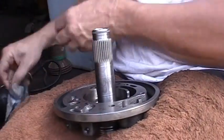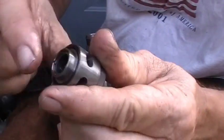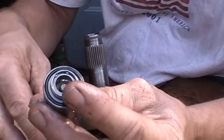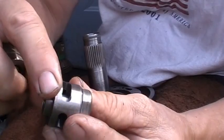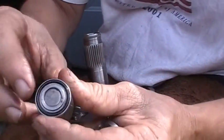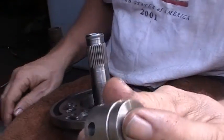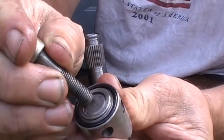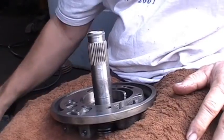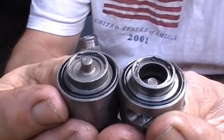Let me show you — here is an old one. See how that is down in there? It's jammed, it won't come out of there. What happens is your transmission starts getting bad and you get metal in the line, metal in the oil, and it circulates through the transmission. If the filter doesn't catch it, fine particles get down in there and jam this up, and that valve is stuck open — this is why your transmission won't move. Here's a different type of valve — there's a spring in there, and on the back side the pressure gets built up and pushes up on it. That's how this particular one works. This is a good valve. There's a good one and there's a bad one — see the difference? Valve is stuck in this one.